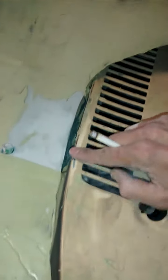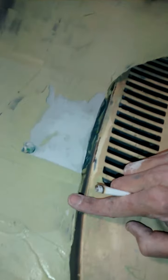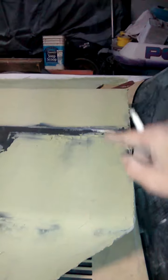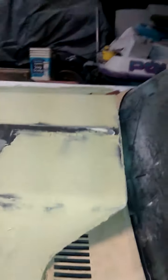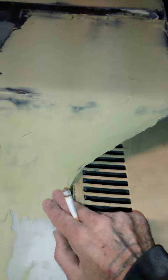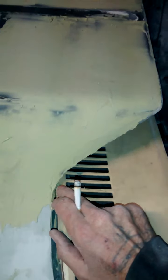When it hardens tomorrow I can go back and clean my lines out, make them nice. Another thing — on each side of the hood, this cowl panel has got a good front. You can see right there it's not all the way to the front; there's only going to be a quarter-inch gap along here. It used to be about three-quarters of an inch short on this side and about three-eighths of an inch shy on that side. So I re-fiberglassed all that stuff as well, and these radiuses went up and back — I filled them in, they're an eighth of an inch from the cowl on each side.